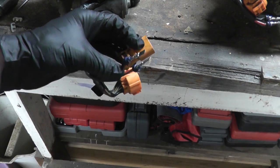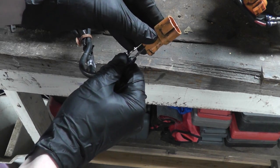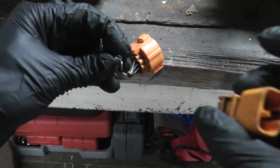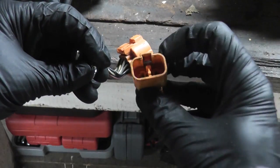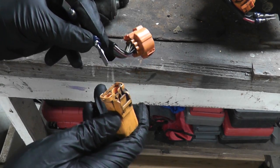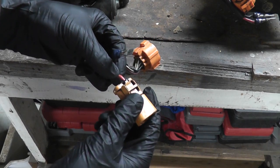It's critical you get the wires in the connector properly — you don't want to reverse them by accident. Make sure the side of the terminal with the two spikes is facing towards the clip in the connector. So: squeeze tab facing up, black on the left, red on the right. Installing it is a lot easier than removing it — just insert it until it clicks.